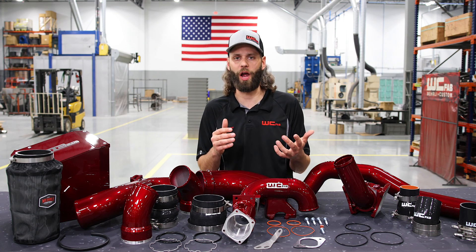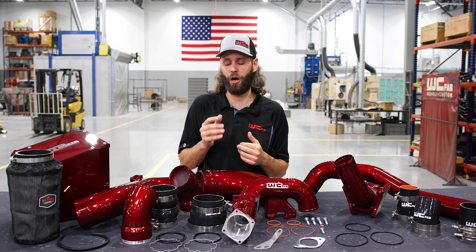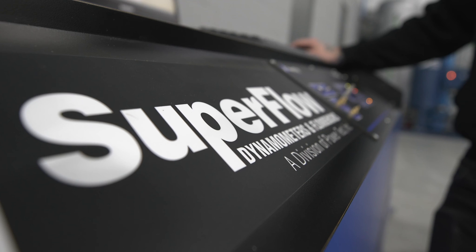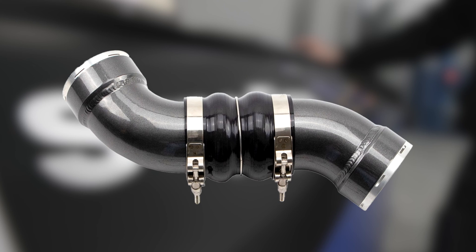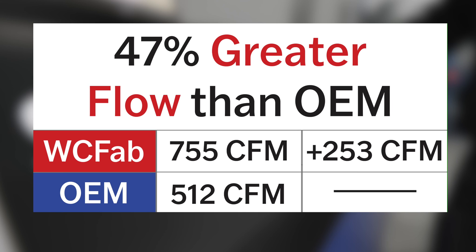Flowing from your driver's side pipe through your intercooler — whether you have an OEM intercooler or aftermarket, either is fine — we then go to our cold side pipe. The factory cold side pipe on the LBZ LMM Duramax is about three inches and it's plastic. These trucks are ten plus years old now and it's not uncommon to see those plastic intercooler pipes starting to fail. We've upgraded to a three and a half inch pipe, which is a massive increase in airflow over stock. On the flow bench, the OEM plastic intercooler pipe assembly flows 512 CFM at 28 inches water column, while our three and a half inch high flow intercooler pipe assembly flows a massive 755 CFM — a 47% increase over factory.